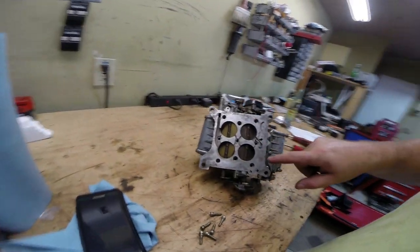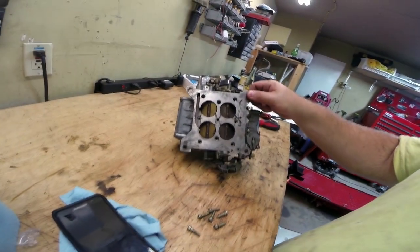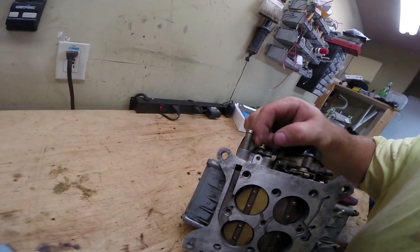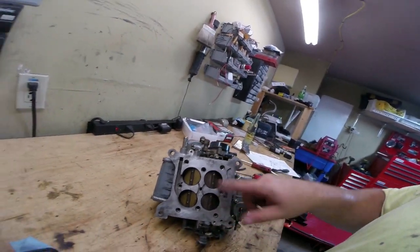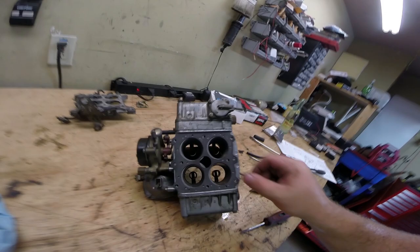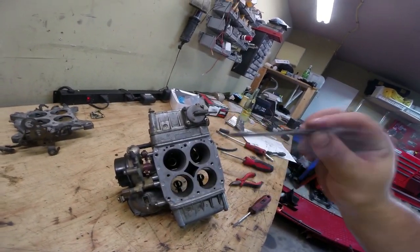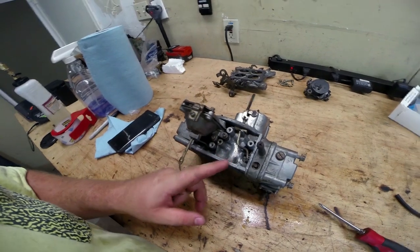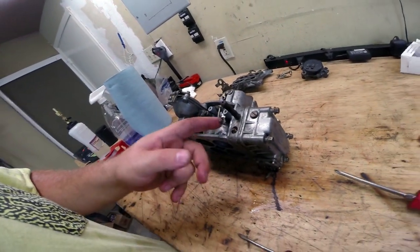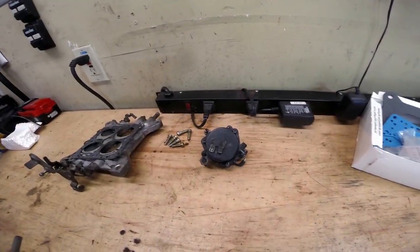The first step is to take out these six bolts that hold on this part. Then you've got to take out a tiny little C-clip right here, which is going to allow you to remove this whole throttle plate assembly. Now we're down to the carburetor body and there's a gasket that goes right here — we can take this gasket and set it aside. With three Phillips head screws, the electric choke comes off and there's a little tiny clip right there that holds it on. So there's your Holley electric choke.